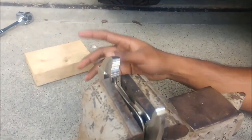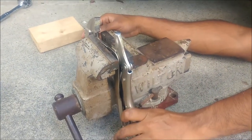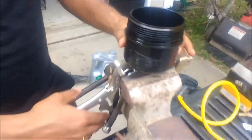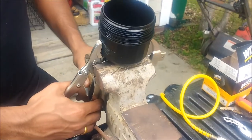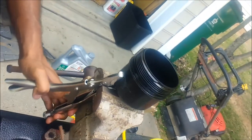We may have gotten that oil filter loose enough. This is what we ended up having to use — we basically used a vice grip to grip the filter, and then a real bench vise to grab the vice grip, then rotated the two sides of the bench vise. You may say that's ridiculous, but we tried like 35 other things before we got here. There's a plastic collar around the filter — with this method we scratched it a little bit, but it's thick plastic so it did not hurt it at all. We grabbed the filter with the vice grip, then used the bench vise for leverage, grabbed the vise with the vise, and twisted — and that worked.